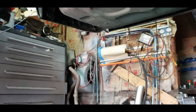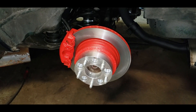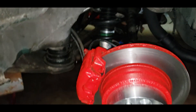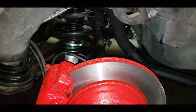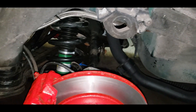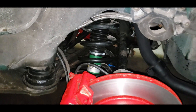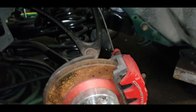She's up in the air. I still need to put the wheel lines — the hubs — on, which are sitting there ready to go. Hopefully this thing will be on the road in a couple of days. Got the brakes and half shafts on. I do have Corvette rear brakes for this, but I'm not going to put them on yet because I'm trying to get the car together for the Woodward Dream Cruise coming up. I routed the exhaust and got that figured out — nothing's pinned up yet, just sitting in there. Got the axles in with all the new gears, struts, and whatnot. The axle's done. Eventually I'll upgrade the rear brakes to Corvette as well.